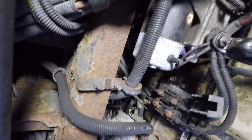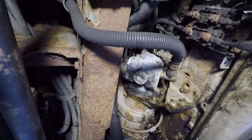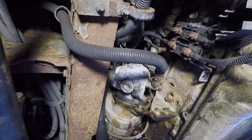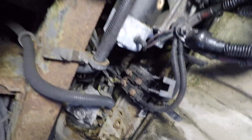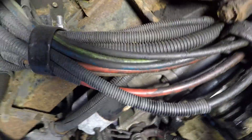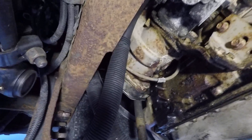But with the Sprinter van, because it's a unibody and the frame rail is almost tubular with light gauge metal, it concerns me. If road salt gets into the corrugation it'll internally rust and you won't even see it. After owning two Sprinter vans I think I prefer having a frame where I can see what's going on. The Sprinter gets great gas mileage, but the money you save on fuel you spend on repairs — so it's about 50-50.